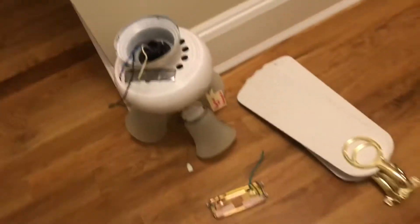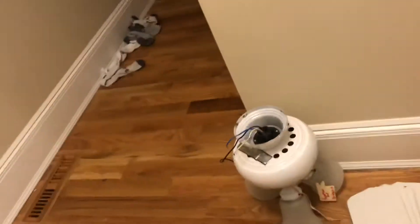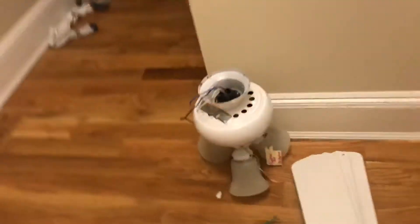Overall it still works, but I'd recommend noting that there's a capacitor in here and you have to give the fan a push to make it spin because the capacitor isn't strong enough on its own. Give it a big powerful push, then turn it on high speed and it will go at a medium speed — the capacitor is a little sluggish and just needs to be pushed for it to work.